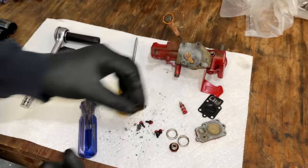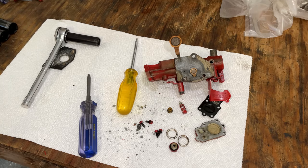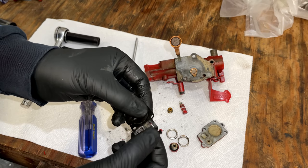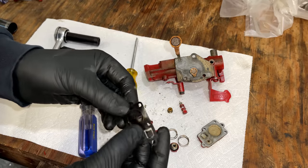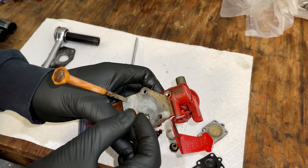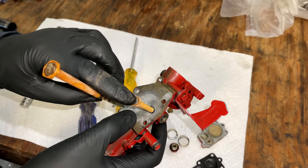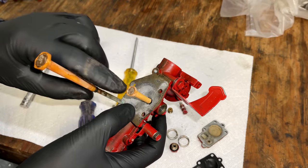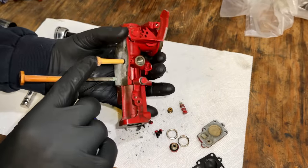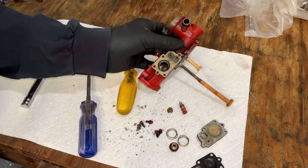It's not clogged. So yeah, this carburetor actually, besides the diaphragm, was in really good shape, but the bowl was empty. So I'm thinking that the diaphragm's to blame. It's just too crispy. Check valves aren't in great shape either. So I don't think it was able to pump fuel up. You know, potentially one of these tubes could be clogged, but I noticed they both have screens, which is good, especially on the bowl. With that rust in the bowl, if a piece breaks off, that should prevent things from getting clogged up. So I'm just going to spray through here a bit with some carb spray, see if I can make it all the way through, and we'll let this soak for a little bit in the ultrasonic.